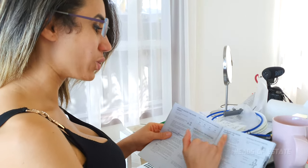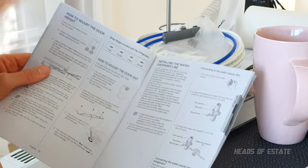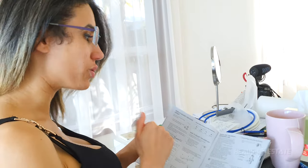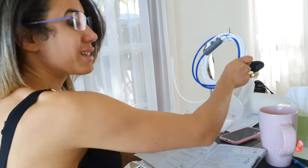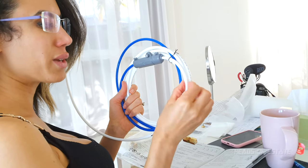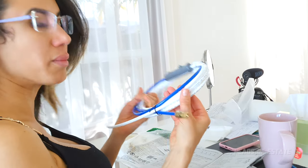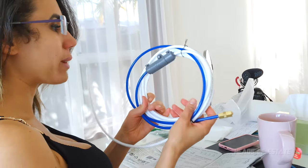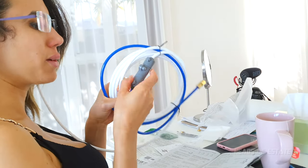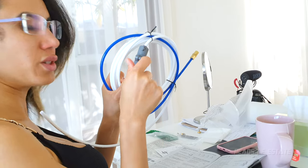...is how to install the water line dispenser. It has a really step-by-step guide. It says to use the new hose sets provided — do not reuse any old hose sets. It gives you a white hose set: one end attaches to your tap directly. I'm going to guess it's about two metres, so it might not be enough for us. It has a little stopcock inside which allows you to put the flow on or off, and then this connects to the fridge around the back.